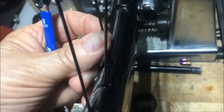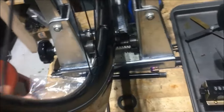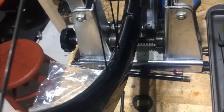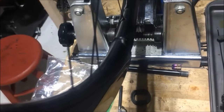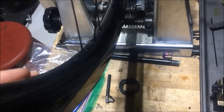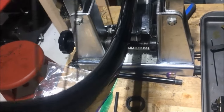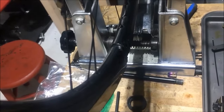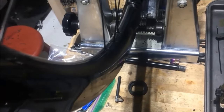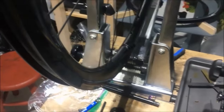So anyway, the next step is to move these spokes over to the new rim, and once they're installed, it'll be just a simple matter of doing the normal tensioning and truing. That should be fairly straightforward. And then once that's done, at my leisure, I will dissect this rim, and we'll show how those nipples work. Pretty fascinating stuff.